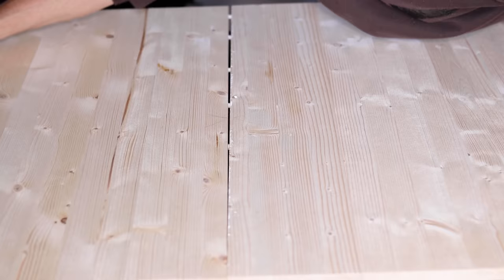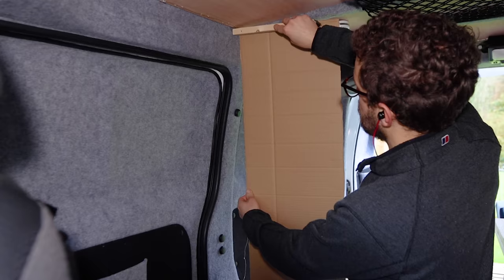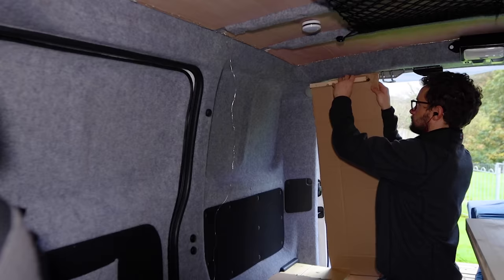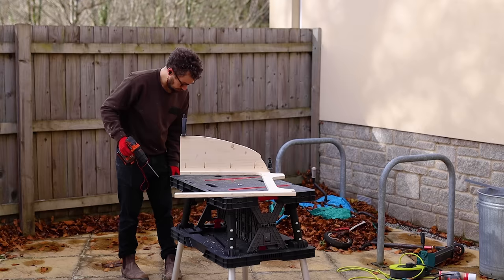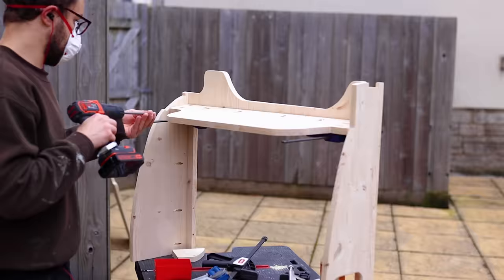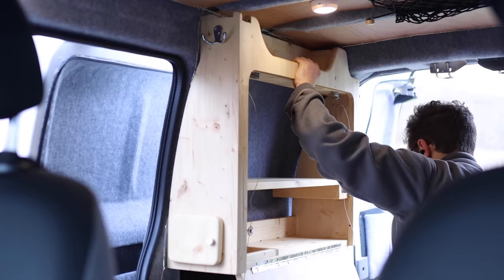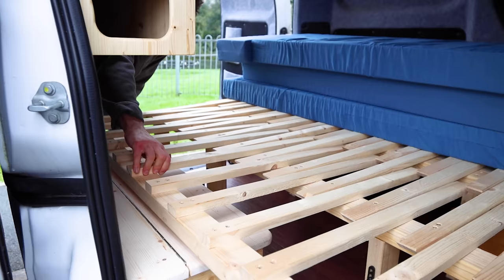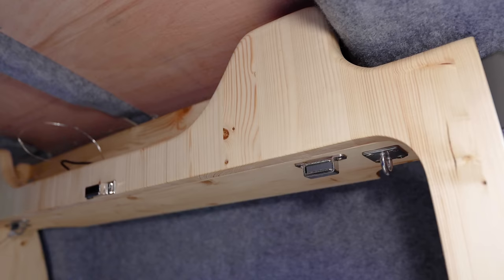The piece of furniture that took the most effort was definitely the wall-mounted folding table and storage unit. I started by building the front section, then cutting the table out to re-attach later. I made the sides to sit flush with the many contours of the van walls, added a base and numerous shelves, then attached the unit to built-in threads in the van wall with five high tensile M6 bolts. The table floats on the wall so the bed slides underneath with ample room.